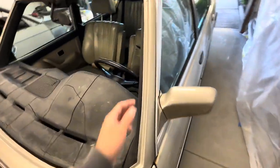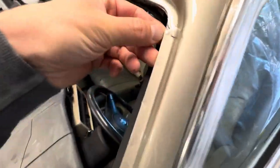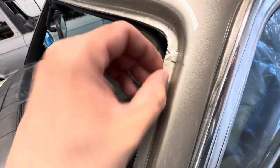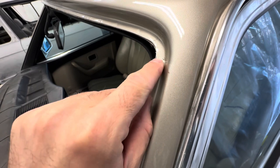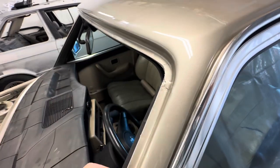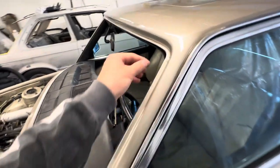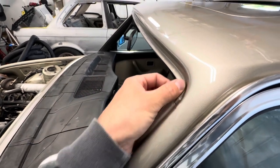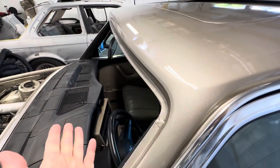It needs to get to where I think it should be before reinstalling panels and seals. Usually I'll push with my fingernail in an inconspicuous spot and you can see it dent — that's how I can tell when a clear coat has hardened up. When it's really resistant to light fingernail pressure, I know it's pretty much ready.